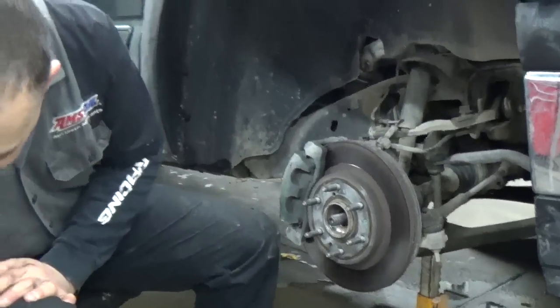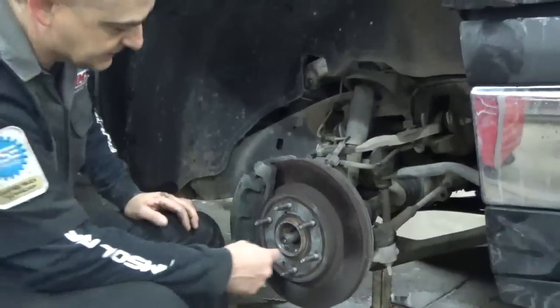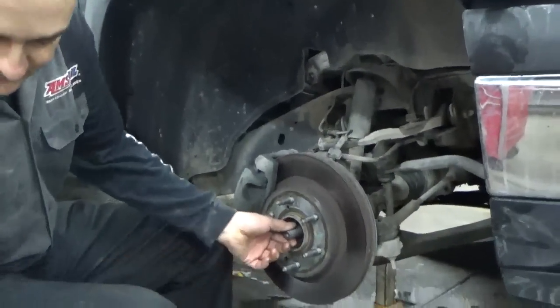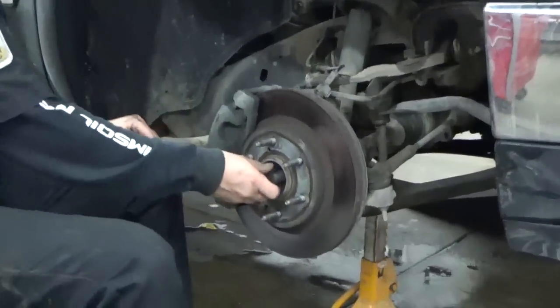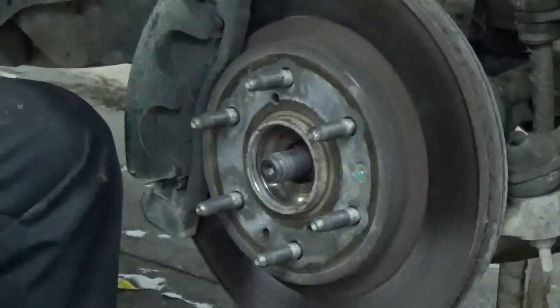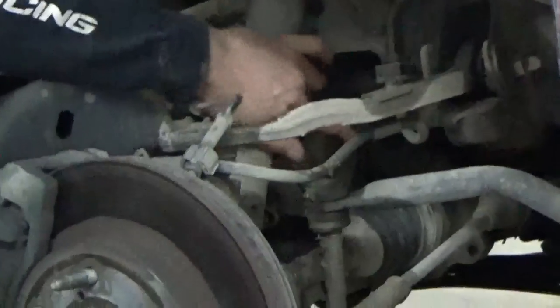If you don't have that, a guy can use a screwdriver or a small chisel or something like that to get it back out, but that kind of saves a lot of the damage. There's going to be a nut under here and a washer. We've already got that off. We're going to buzz those off, and then down inside here on the half flange we use a universal and just go in there and buzz that off. We've got them mostly all off already.